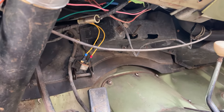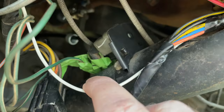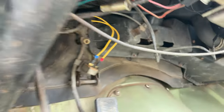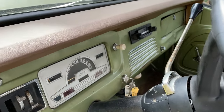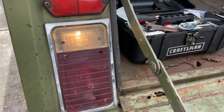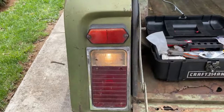Everything's hooked up - I extended those wires to get down to the kickdown. Everything's plugged in up here - you can't see it because of all the tape, but it's all plugged in. Backup lights here, kickdown switch here. I made a new jumper wire - this green one - to go from the switch over to the neutral safety for the reverse lights, and they're on the accessory circuit. Putting it in reverse - we got a light. We don't have a light over here because this one's not working, but the light works.